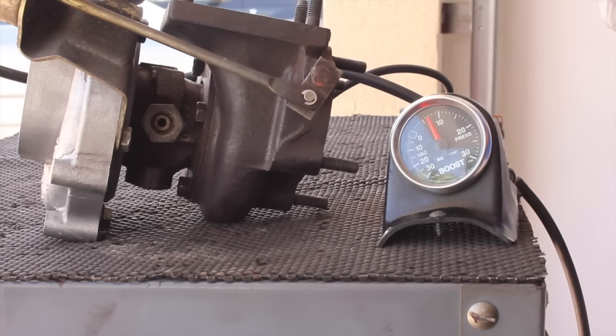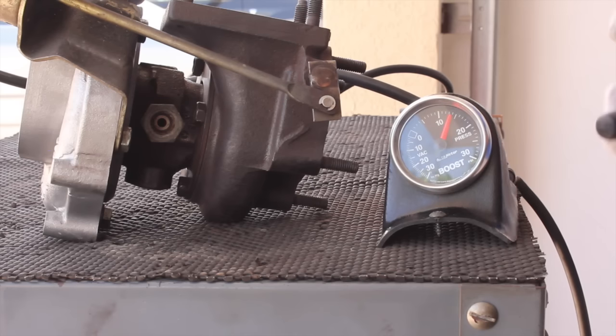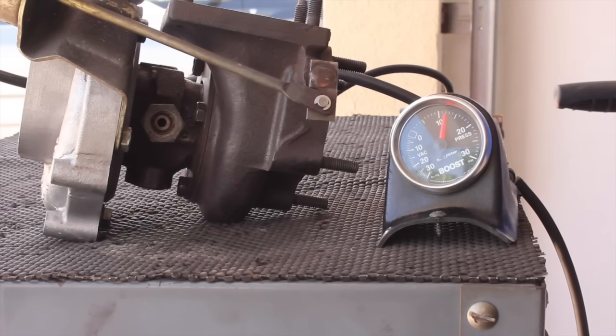Make it bleed back, and you can watch it again — around 7 psi it'll start to come off its seat, so she's pretty much fully open at 7. The spring rate in here is probably around 7 psi, which is what a factory SR20 would probably be running around.